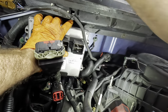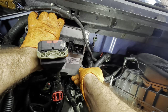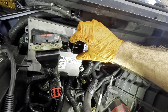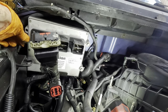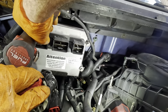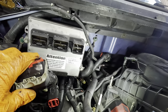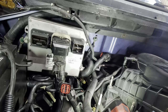And you know, I could be wrong, but I'm not of the opinion that it's a phaser issue again. It could be a phaser issue, but I believe it would have been caused by an oiling issue, because I think that some of that packing material was ingested by the engine. It may have been consumed by the engine and is no longer relevant to the situation at hand, but that doesn't mean it didn't cause damage while it was in there floating around. And the filter might have caught it, and the filter might not have. We don't know. I didn't tear the engine apart to find out.